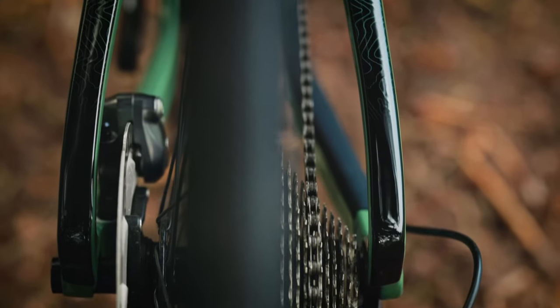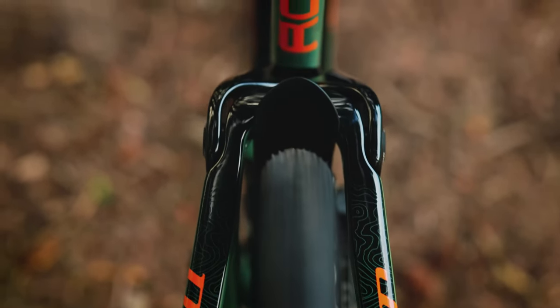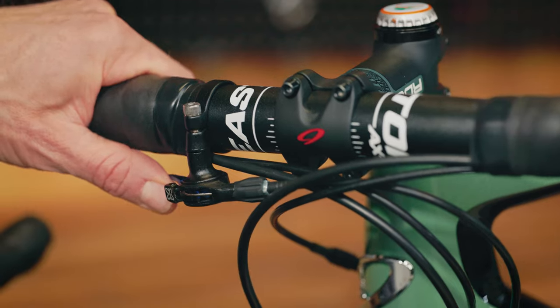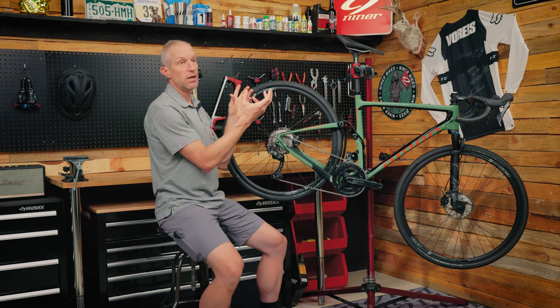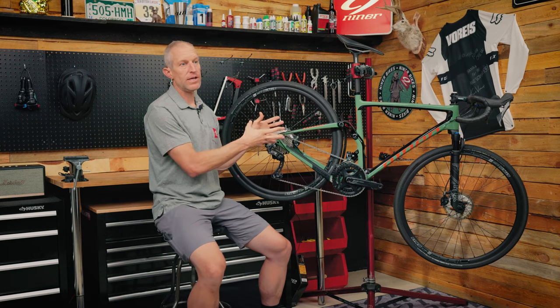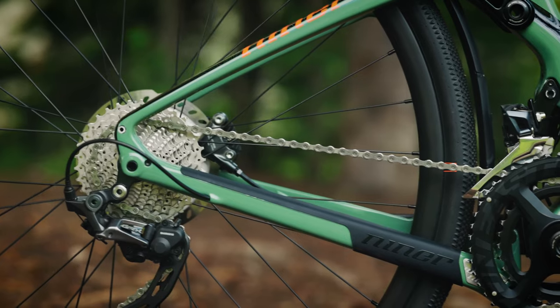50C tire clearance, so you can squeeze some pretty large gravel tires on this bike. Check with the fork manufacturer regarding front tire clearance as it varies by manufacturer. There are a lot of gravel suspension forks out there now, so that'd be a fun way to customize your MCR. Handlebar lockout to lock out the rear shock — so if you are on pavement, you can lock it out. On the main triangle of the MCR-9 RDO, there's a significant number of threaded fittings for bottle cages, custom Niner frame bags on the top tube and inside the front triangle, plus mounting points for fenders and cargo racks. It's really meant as a multi-purpose machine for long adventures and short rips around town alike.